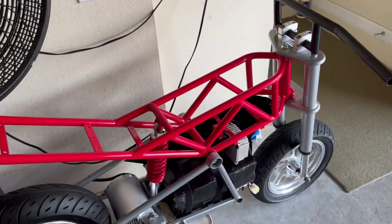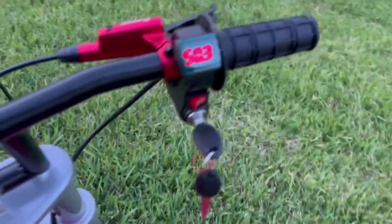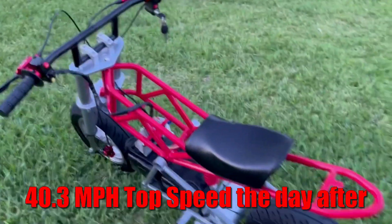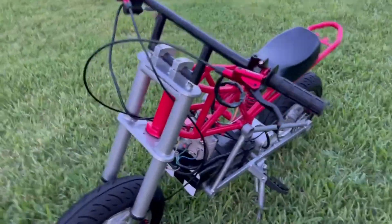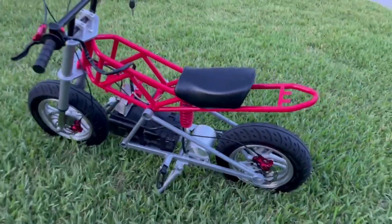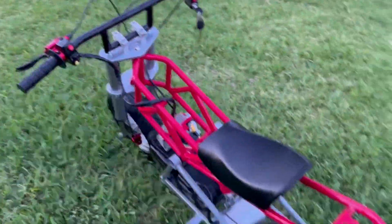Now I'm just connecting the wires and adding the throttle and brakes. Here's the final 48 volt, 2000 watt build: 2000 watt motor, 48 volt 14 amp hour battery, Kelly controller, and a three-speed throttle with a key. I got up to about 37 miles an hour, which is pretty epic for a bike this size — honestly I don't know if I'd want to go any faster, it was a little dicey. I put the MX650 fork on there and got the hydraulic zoom brakes. Now I'm going to add peripheral stuff like a headlight, horn, and some LEDs.